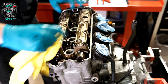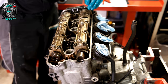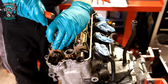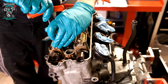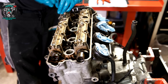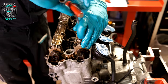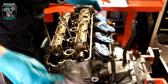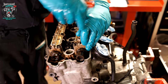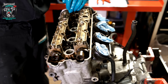Right, so I've got all the bolts out apart from the ones on the ends, and I've got the ones on the ends just cracked off. Then you slowly undo - you can feel which ones have got tension on them. They come up nice and level, straight. I would do the same thing with assembly - just pull the cams down nice and evenly. If you're doing one yourself, you might want to observe the camshaft timing marks and familiarise yourself with them. It's old news to me, but always a good idea if you haven't had something apart before.